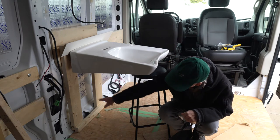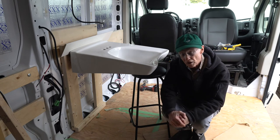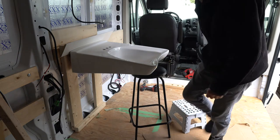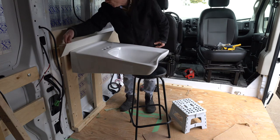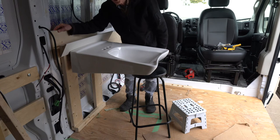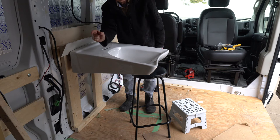And that's these 2x6s that I have running vertical that are inch and a half wide. And what that does is there's a coupling on the back of the steel bars that run through here, go all the way through, and it's at the back. Because that bar is running through 1, 2, 3 pieces of 1.5 inch thick wood, the thread on that bar is only being exposed about that much, maybe an inch, and the coupling is longer than an inch, and therefore I'm not engaging all the threads.